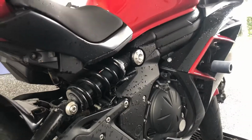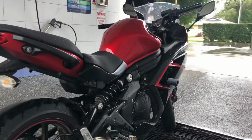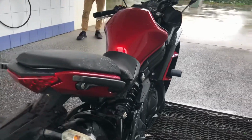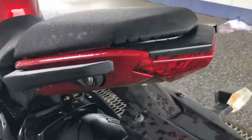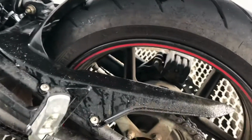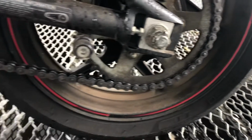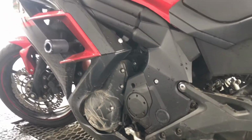look. Please note, some car washes can be detrimental to your motorbike due to the high pressure hoses damaging the bike's internals and exterior, depending on the amount of pressure used. Also, do not do this process if you have a leather seat, because leather shrinks when it gets wet. Another thing, using high pressure can be detrimental to wheel bearings, removing grease and allowing water to enter where it's not supposed to.